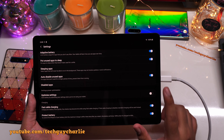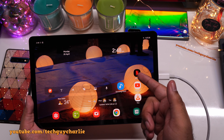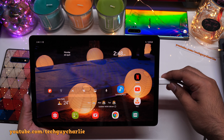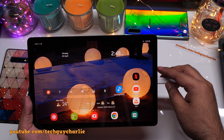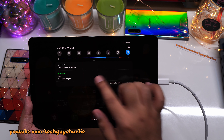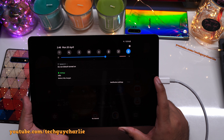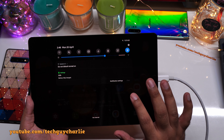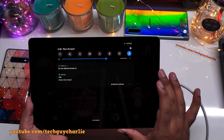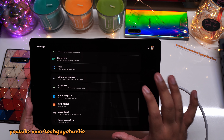If you are someone who watches Netflix or plays a lot of games on your tablet, I personally watch a lot of Netflix and YouTube and just leave my tablet plugged in all the time. But with this feature turned on, the charge level is limited to 85%, and because the tablet is plugged in whenever I'm watching movies on Netflix or YouTube, the battery does not go through charge and discharge cycles. It stays at 85%, and that will potentially prevent the battery from degrading quickly.